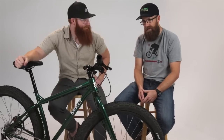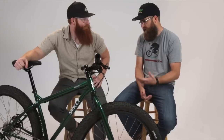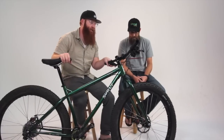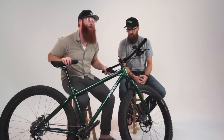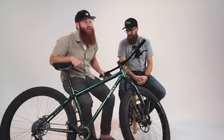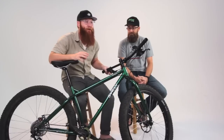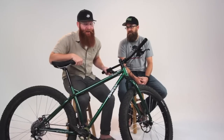I noticed you've got this bike set up mostly stock but I see a few new additions. Tell us about how you arrived at those choices. Yeah, it's almost entirely stock. A couple of things I did just to help with rideability right out of the bat — I'm a pretty heavy guy. This bike comes with a 34-tooth single ring in the front which for me was a bit steep, so I put a narrow-wide Race Face 30-tooth chainring on the front to make the climbing a little bit easier. I haven't noticed a big reduction in speed at the top end, and the climbs are definitely more manageable. Coming from a triple crankset down to a single is still a big change, but I've definitely liked the simplicity of having just a single ring up front.